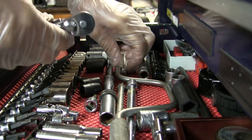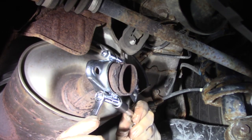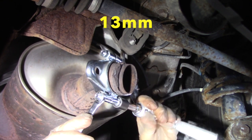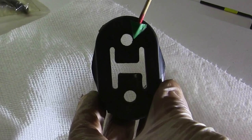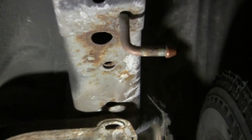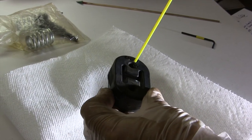The nut and bolt are both 13mm. The old rubber hanger was undamaged, so I just reused it. It attaches to the body by this hook on the frame rail. I applied spray lubricant to ease putting it on.